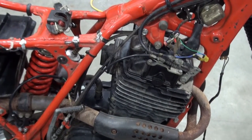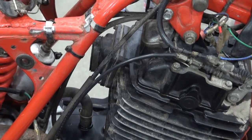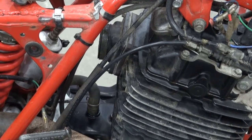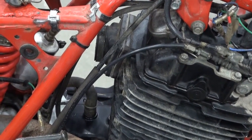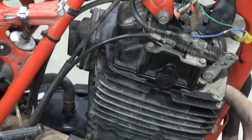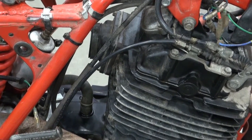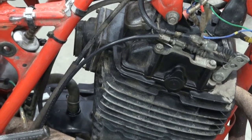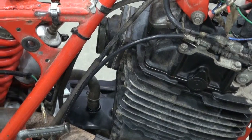What the reed valve can actually do is restrict the airflow as airflow is increased. So possibly already in the mid-range, and likely in the top end, the power has actually diminished somewhat. Exactly when that would start or how much — I don't know. It's a bit of speculation, but I think some common sense logic applies there as well.